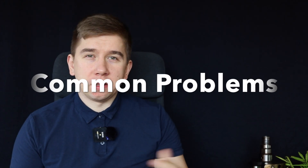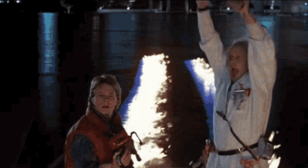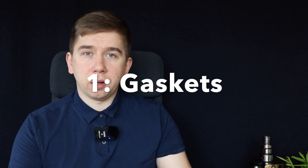Common problems: these engines do come with a few minor annoyances. Their worst enemy is time. As with any other engine, everything that's rubber and used to be soft gets brittle and falls apart. So you will see a valve cover leaking, oil seals, the crankshaft seals — one in the front and one in the back — will probably leak. Check anything that keeps oil in the engine and is soft or rubber, including the hoses.